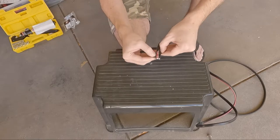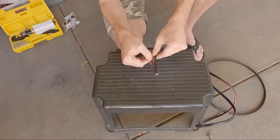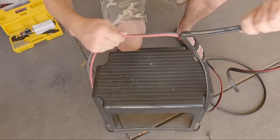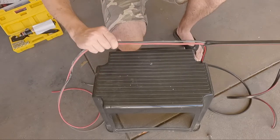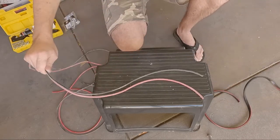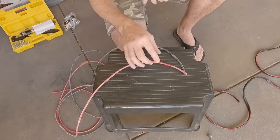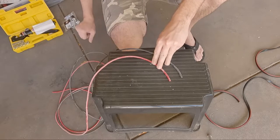You should just be able to now peel that back. Once you get it started just rip it out like so — it is powder coated on the inside so it doesn't rub. I've now separated the wiring. I'll get my split tubing and run the split tubing, and then I'll show you how I'm going to be crimping the terminals on there with the crimper.